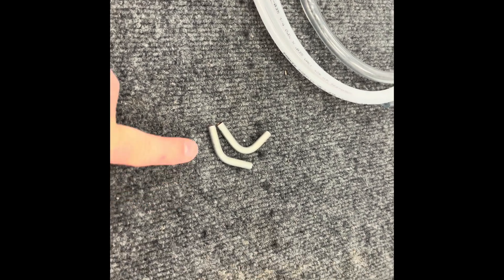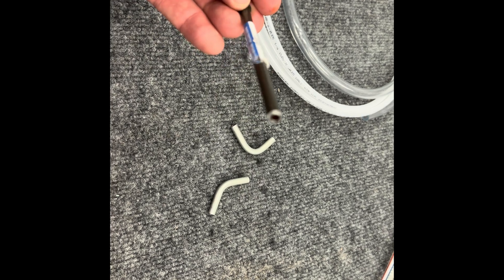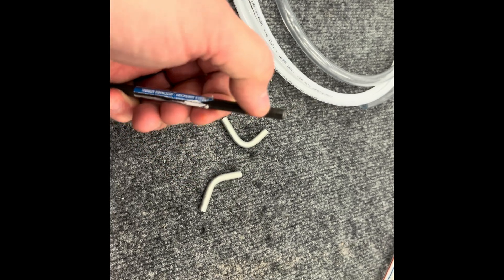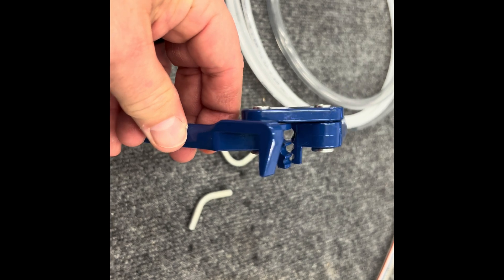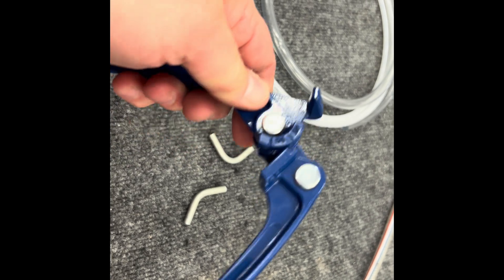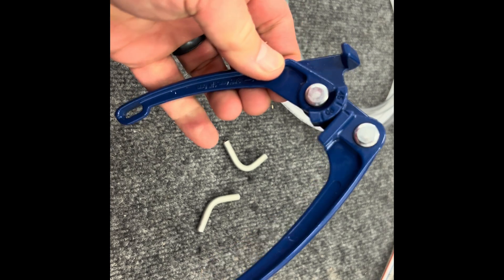I decided I needed to make this longer. So I went to AutoZone and got standard steel quarter-inch outside diameter brake line — a replacement line, foot long — and I cut it to the right size and did some custom bending with a little pipe bender I got from Harbor Freight for $9. You basically put the tube under here and wrap it underneath, then lift it up and out of the way and bend it as needed. Never used one of these before, but it worked well.